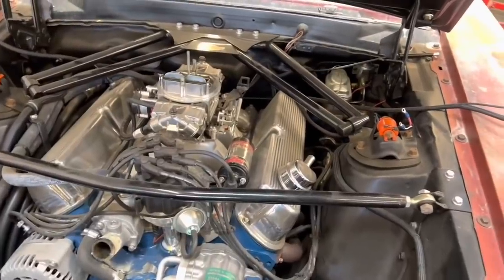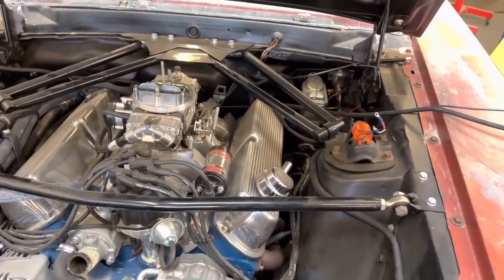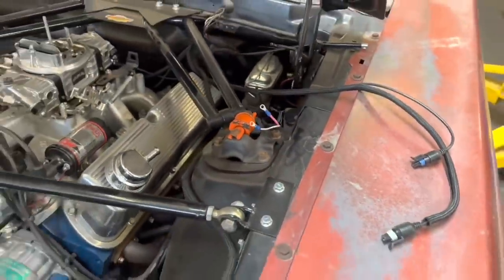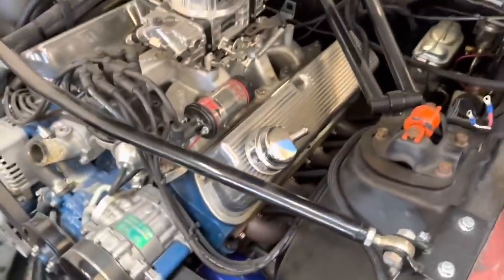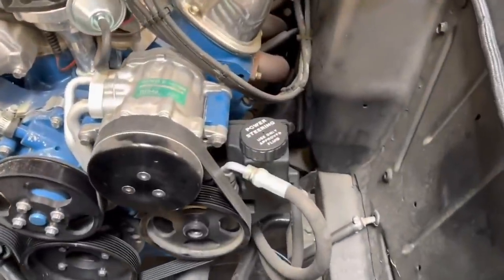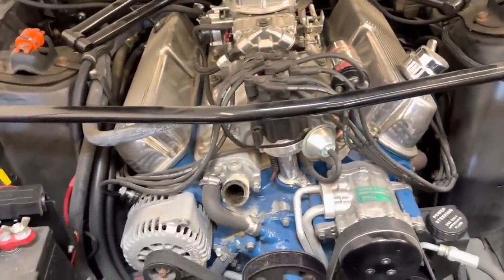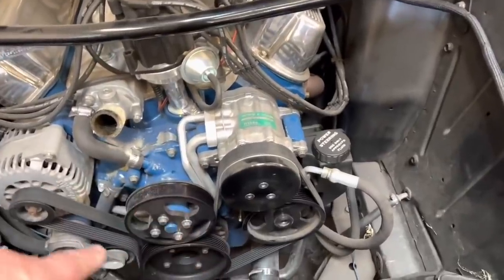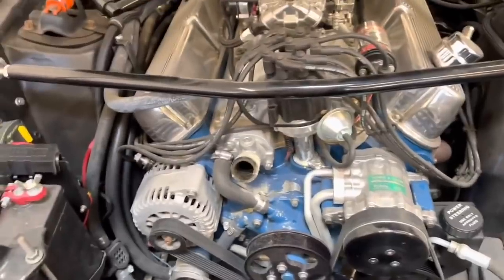So, simple install. This is an Auto Wire vehicle specific wiring harness, and Dakota Digital. So the gauges, the sensors are just plug in, three wires, and then very clean tach and coil. You can switch ignition. A couple of heater hoses, undo the AC lines, drain the coolant obviously, evacuate the AC system. Normally I would take the AC compressor off and set it aside, but this has hard lines that go underneath everything, so you can't take that off. So might as well just evacuate it.